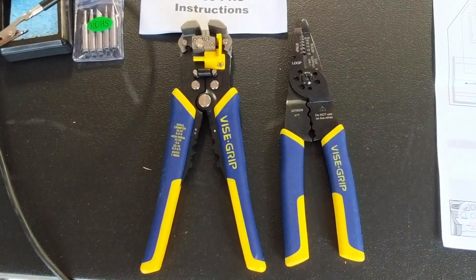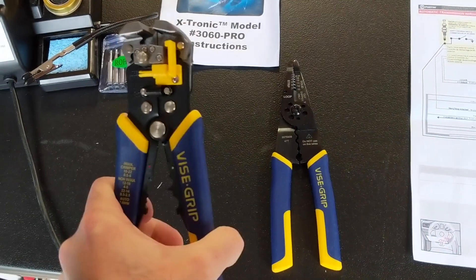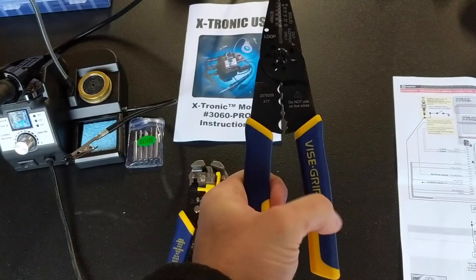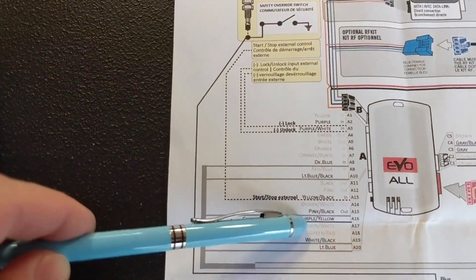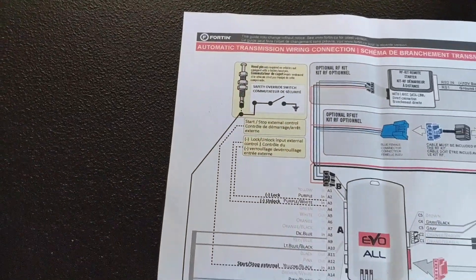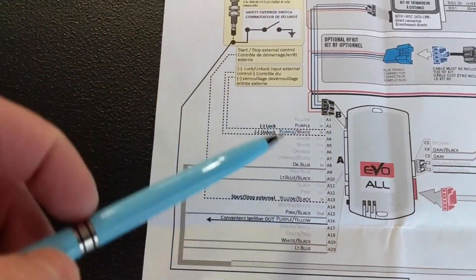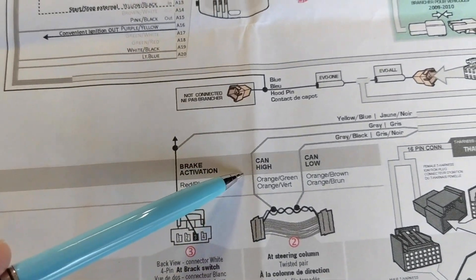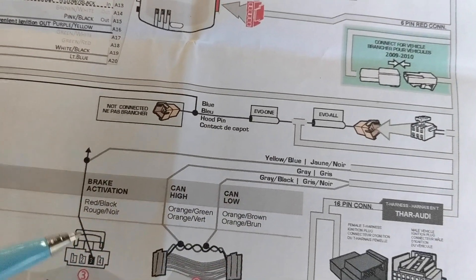These are my favorite wire strippers — I'll link to them in case anyone needs them because this project does require wire strippers. This automatic one might have been too small a gauge wire for this project to work, but as a manual stripper I really like this standard vice grip one. This was the wiring diagram I was talking about. You see this electrical connector, and in the harness itself you have to put this janky hood pin — but I'm not wiring that into my car. Everything that's grayed out is unused — it's in the harness but unused. Everything else is already going somewhere. The only three wires you need to worry about, as I mentioned, are the brake activation wire, the CAN high, and the CAN low — those are the wire colors in the harness and those are the wire colors on the car.